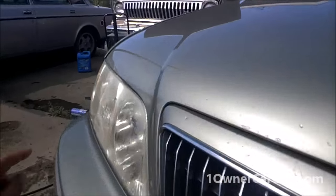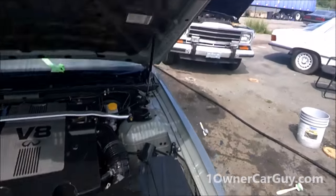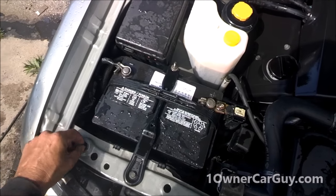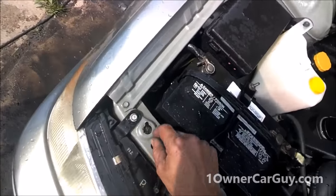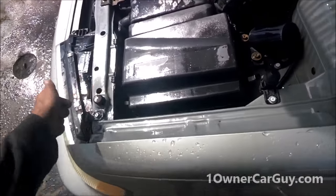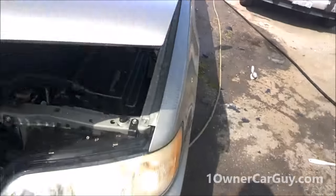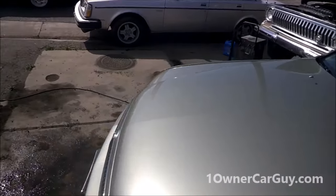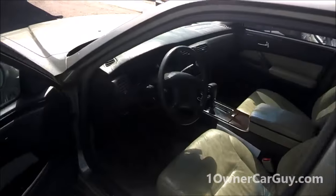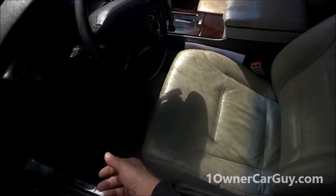Look at that — you see the difference? It's just off a little bit. I think this one is pushed through, and that's exactly why it's not holding. Interesting — I'm going to have to call the Infiniti dealer. That should easily adjust up, but we're not going to be able to get both sides because that side is broken. I could get that adjustment near perfect if I just had that little rubber stop. It's a really easy way to keep your maintenance and keep your panels in alignment. This car isn't smacked up or anything like that — it just has a little rubber piece broken, probably about three dollars on eBay. Thanks for watching.